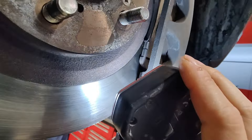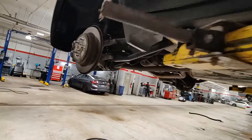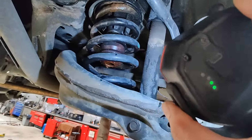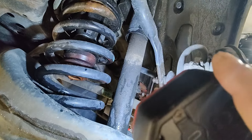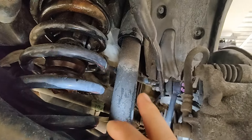Moving along, your brakes are almost done — almost no more brakes. And then going around the back, typical Honda Pilot. When I took it for a road test it was pretty bouncy. This shock on both sides is actually leaked out, so this side is leaking.